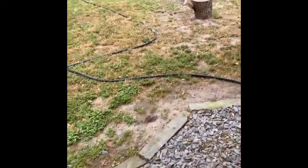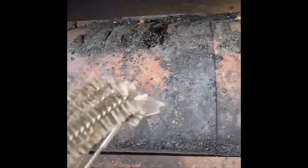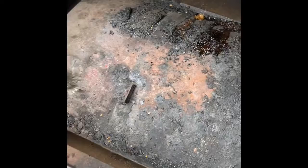This internal tray comes out in two parts — you've got the top part, which can get crusted down by grease, and then the bottom part. I've got a log over there I'm going to set them on to clean. First things first, use your brush or scraper and scrape all the big chunks off, get it all off. Luckily I just bought a new vacuum, so I can use the old one to clean everything inside. Scrape out as much stuff as you can, then use that vacuum to suck it all up.